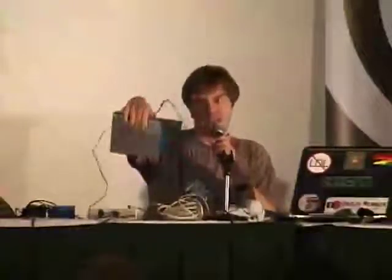So this device here is an AT&T CallVantage, what's called an ATA in the voice over IP world, and it basically means a terminal adapter. And this uses this weird protocol that not many people use called MGCP. And it's all locked up, so you can only use it with AT&T's service because, after all, it was only $19 or something like that at Fry's. And, obviously, it probably cost AT&T more than that. So they don't want you using it with something free like FreeWorldDialup, for instance.